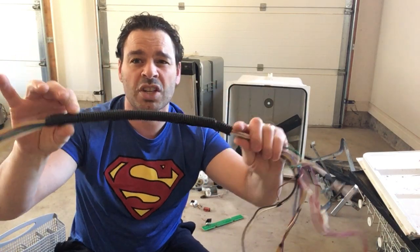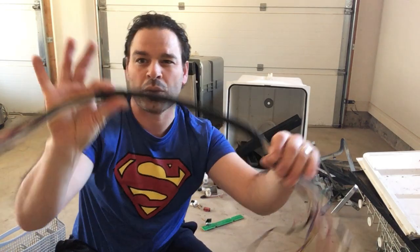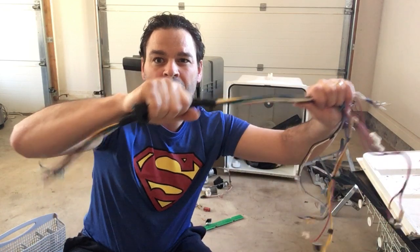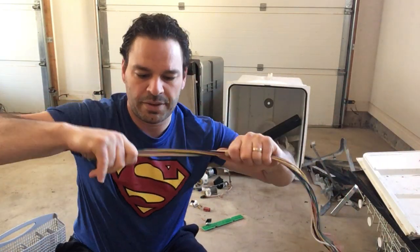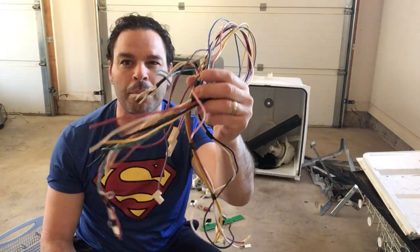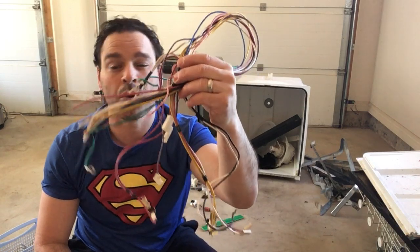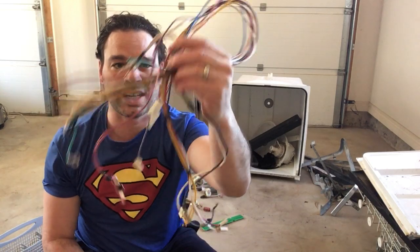The interesting thing is: if you want to maximize this, just slide the outer coating off. I've already removed the tape around it — watch this. To go from 40% to 60%, just slide this off. Now I only have one coating of plastic. I just upgraded that from $1.68 a pound to $2.60 in the matter of two seconds. So that's one thing you definitely want to check.